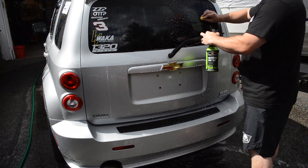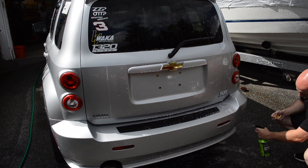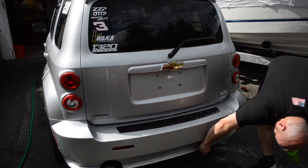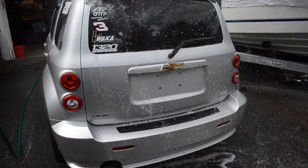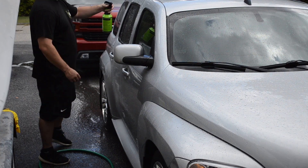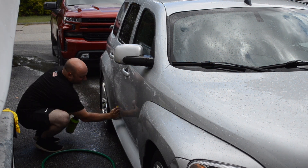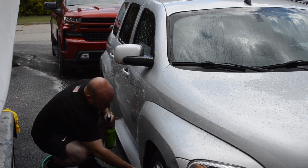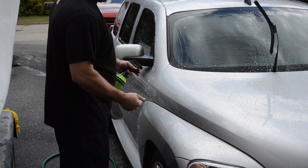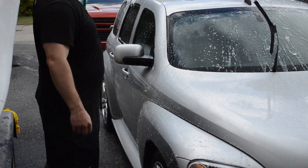I did start the video with a Meguiar's clay bar — gray or white in color — but I'm now using a yellow clay bar, which is actually the Mother's clay bar. I had one Meguiar's clay bar left and I dropped it twice — dropped the first half and the second half within the first two body panels. So now I'm using a Mother's clay bar, which to me is just as good. The claying process is very tedious, and for anyone who hasn't done it before, it's terrifying going over your paint and feeling the bumps as it's taking the dirt out of your clear coat.